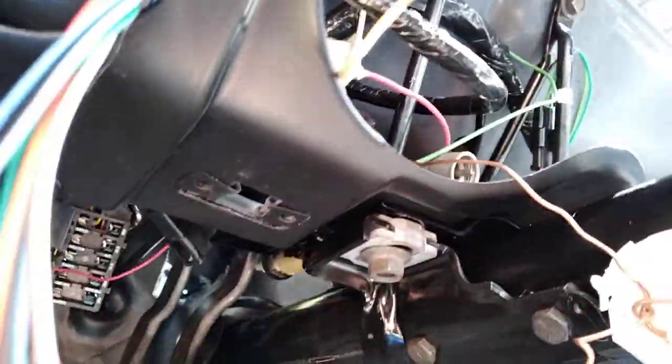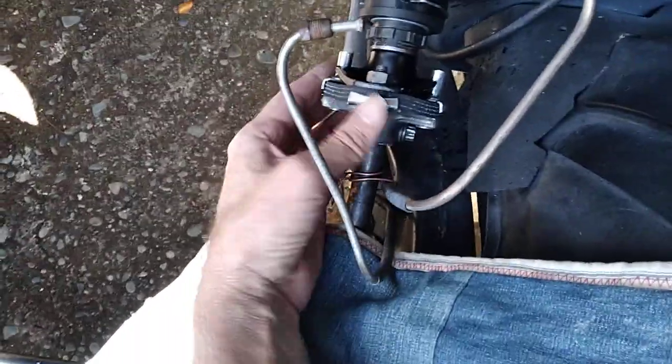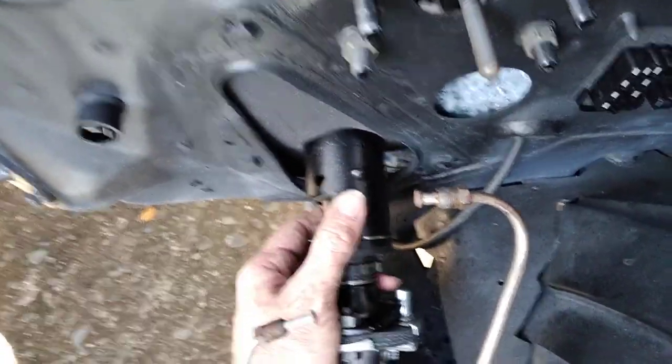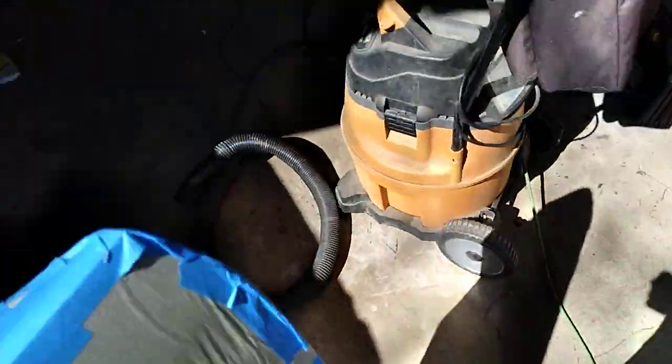All right, the column is kind of just in position where it needs to be. It's locked in at the angle it needs. The bolts are in just a little bit, just enough to catch a thread. And I've got these two nuts here on the rag joint, not super tight, just snug enough to pull this in right away. And then here we've got our seal. Now that the column is in the right position, we can get that seal and the bracket installed.